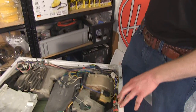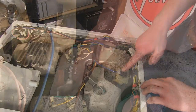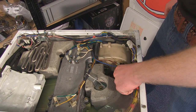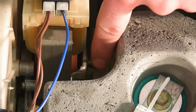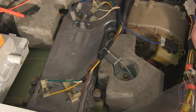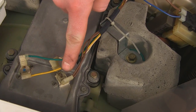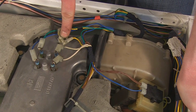The next place to check is the fan. Fluff or lint can enter the fan, stopping it from spinning effectively. A very easy way to check the fan is to spin the motor cooling fan on the outside, which is connected to the heater fan via a spindle. This is spinning very freely, not obstructed. Now if you have a very high resistance reading and your thermostats have buttons on the top, press those — that effectively resets the thermostats.